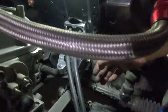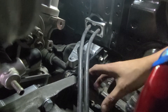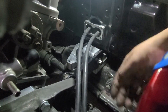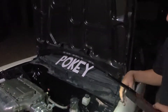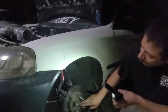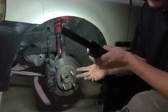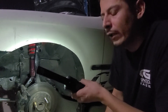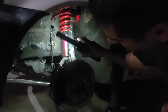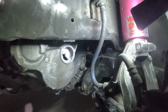If you want to go all-wheel drive, the only thing you're gonna be changing is the T-bracket — easy. Of course you'll also need the all-wheel drive inner housing and the all-wheel drive T-bracket. I'm going to end up using 32-millimeter axles. I think the last ones I used were RSX base or EP3 base, but we'll find out. For axle placement, you need K-series of course.